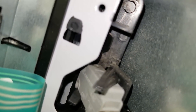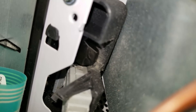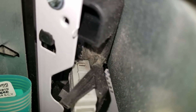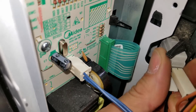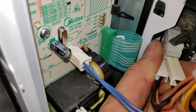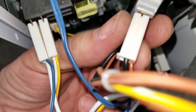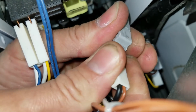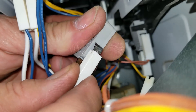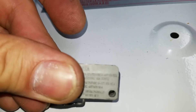If I can get in here — I think I see right off the bat, it's got no lever. The push button for that switch is gone. On most of these Panasonics, you can just push these little tabs up and out and the switch will actually pull right out. Let me very carefully unplug it. There — there's the button, totally flush with the top of the switch.